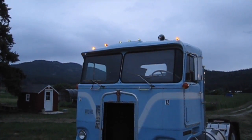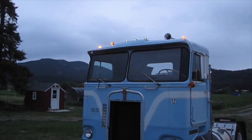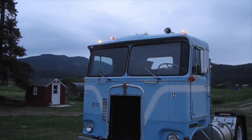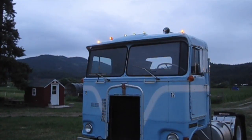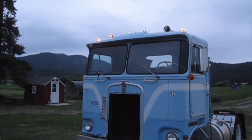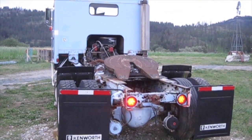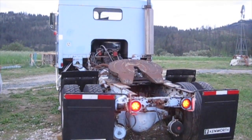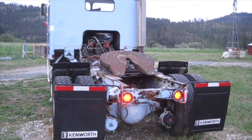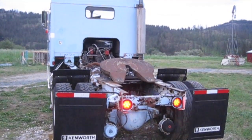It's a little bit darker out now, it's in the evening, and I thought I would turn on the lights just to check them. These are the clearance lights. The lights themselves have been installed for quite some time but I just got them wired reliably today. I'd had intermittent trouble with them and I found somebody had repaired a wire with a suitcase connector and did a pretty poor job of it. I repaired that and they seem to be working properly. The big accomplishment of today was the tail lights — I had to make a whole new wiring harness to run forward along the frame and they're working. Tail lights are working, brake lights are working, and I hope the turn signals work but I'm still working on putting a new signal stat on the steering column.